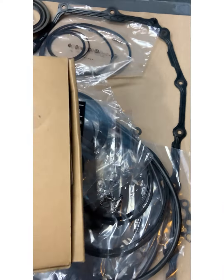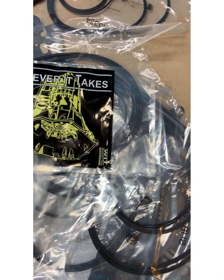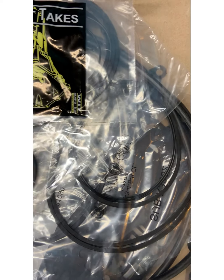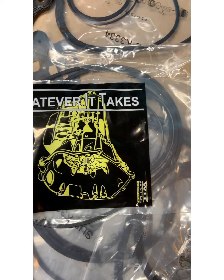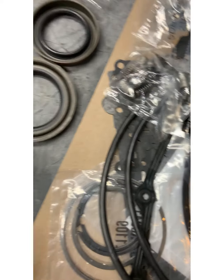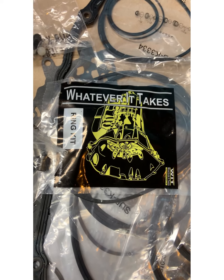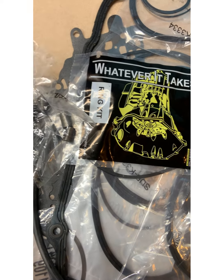We have our single molded piston here — this is for one of the brake clutches — and a series of nylon thrust washers. This is actually the seal for the pump right there; that's our vane type pump. Here I see a front seal and rear seal. Now you're probably asking why there are different types — one is for a two-wheel and one is for a four-wheel application. I have a collection of them here, but I'm only going to use two of these seals; the others will be left over. These are aluminum bolts.